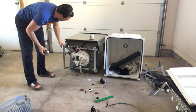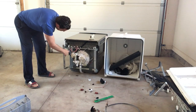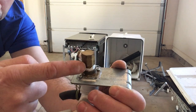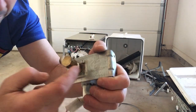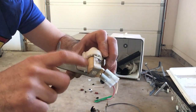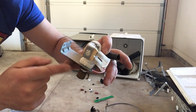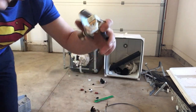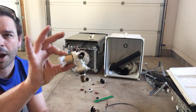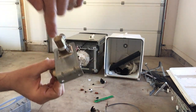On the side of one of these there's always going to be a small motor that connects as well, and a little hose connector that is going to be yellow brass — I just have to take it out of the screws. These also have copper in them — I actually have a video opening these up, very simple to do. If you do not want to waste the time, you can still put these into your copper bearing motor pile and get the 10 to 15 cents a pound, but definitely want to get that brass.